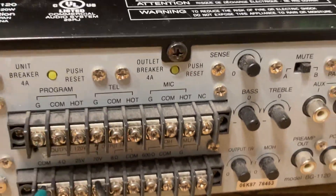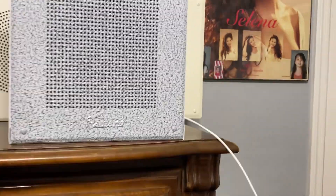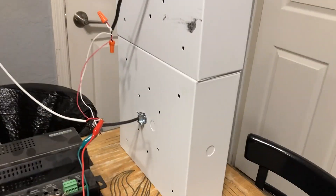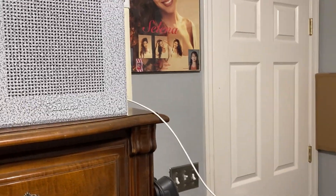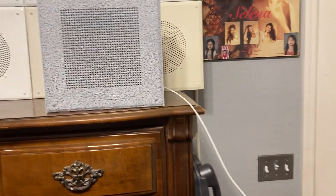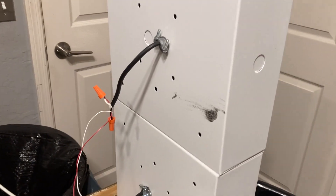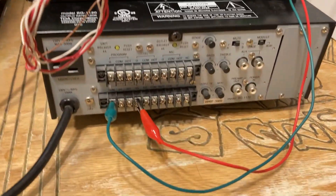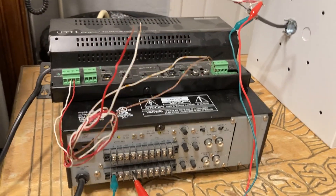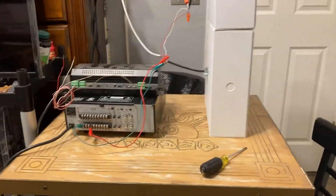There's COM right here and there's the 70-volt terminal — those are my lines screwed into those terminals. So that's five watts, two watts, and one watt — that's three watts plus five watts — you're using give or take eight watts out of this amplifier with just three speakers. Always keep track of your taps; mark them with a sharpie or take notes so you don't exceed the amp's power rating. I try to leave about 10 watts of headroom — that is recommended by manufacturers and professionals.